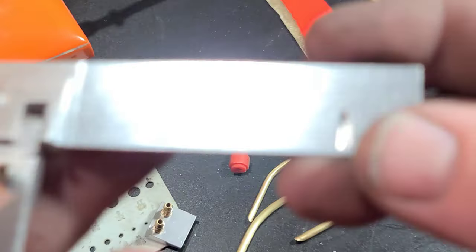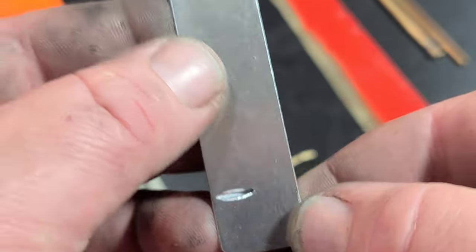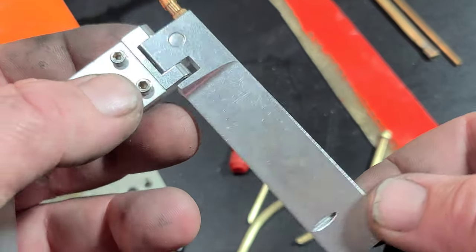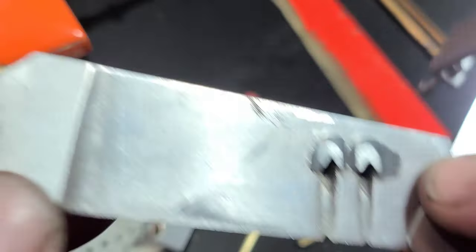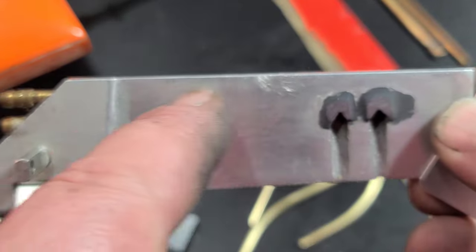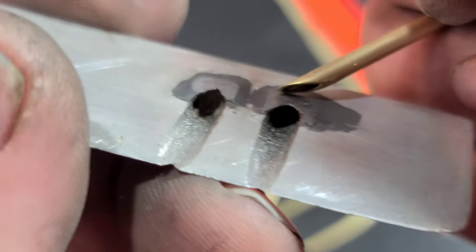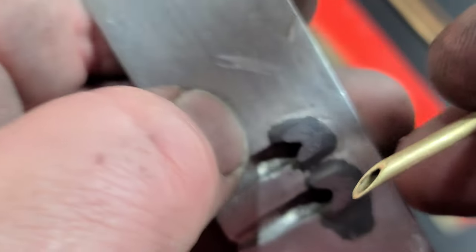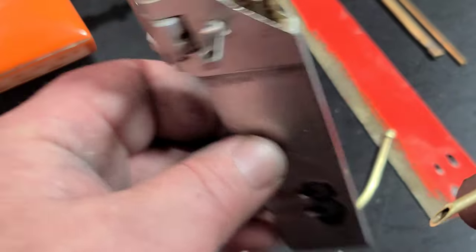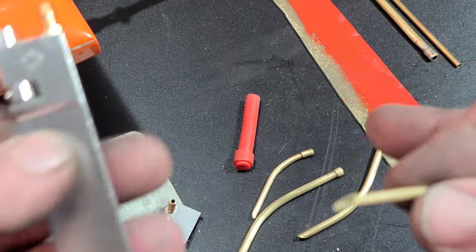You might think use the big one for more flow, but you get just as much if not more flow with a small intake hole. I've drilled out my holes on rudders and lost flow. I drilled out the intake hole and lost flow - hence the reason why I welded an area on the pickup itself trying to make a little cup to pick up more water, but that messed up my high speed and caused the boat to chine walk real bad at speed. So I'm taking all that I've learned into consideration.